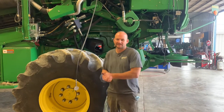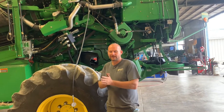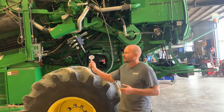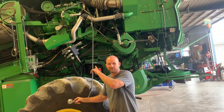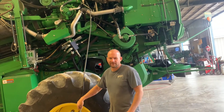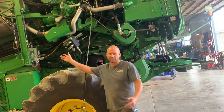All right, so we got our S690 put back together and it really works properly — I'm real happy. We had the correct diagnosis on the clutch being bad. A couple tips for you: if you want to test it, check pressure going to that clutch at the gauge port up there. 150 to 180 PSI is the pressure reading — we had 175.